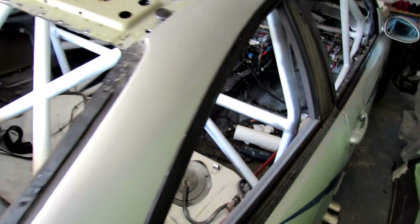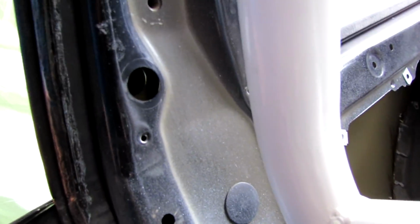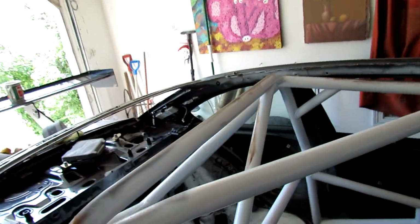I got it off. So the motor was the only thing bolted in the back, but the very hard part was there's basically hinges right here, and they bolt through the inside to hold it on. This hinge you can get to because it's easy, but the cage was totally blocking this hole, and I couldn't fit a socket or anything. I could only fit a short 10 mil into that hole, and then I took a flathead through this gap and spun the socket with the flathead. It's very, very complex, but the other side's a bit better, so I'll show you guys on that side.